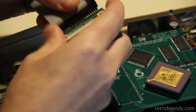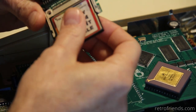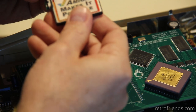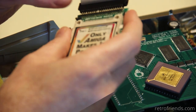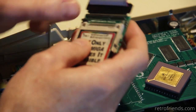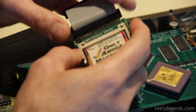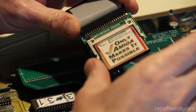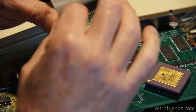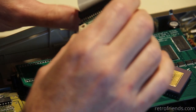It was shipped to me like this with pin one on this side. I'm not even sure if this compact flash is good — it looks like it's got some wear on it. I don't think you can set this to master; you have to keep it on master either way. If you put this in an IDE chain and it's the second one, that's when you would put it on slave. Otherwise, if it's a single device on an IDE chain, it's going to be always master — otherwise it will never work.